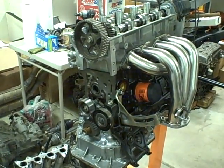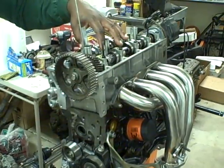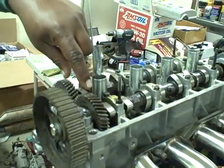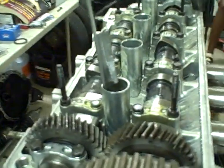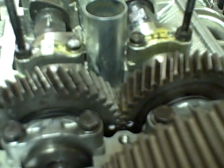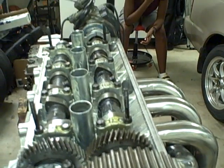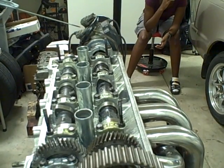The other thing you want to do is make sure that your valves are closed and your timing marks on your gears are lined up — I've marked those in white. There are two little dots that you can see right in here. These two have to line up, and when they line up, that's top dead center. These cams control the rotor which tells which spark plug to spark.